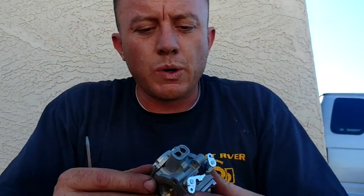Most saws you can start out like that — you're pretty safe doing one full turn counter-clockwise once you dead-end at clockwise. That kind of gives you a baseline. If it's stalling out or idling — again, I didn't want to make this about how to adjust your carburetor — but sometimes it's a turn and a quarter, sometimes three-quarters turn out. You're good doing both the high and the low jet, the H and the L, at one full turn from dead-end.